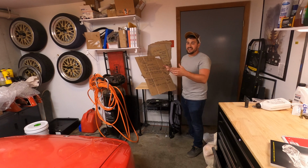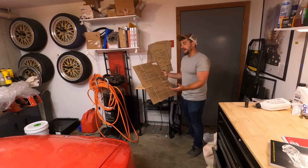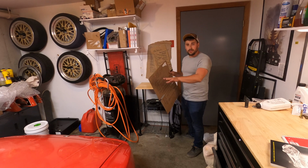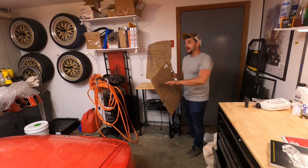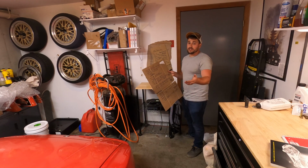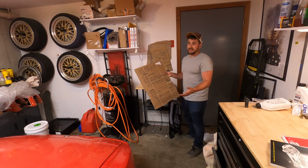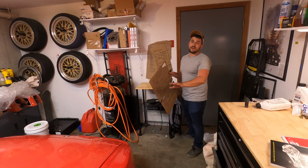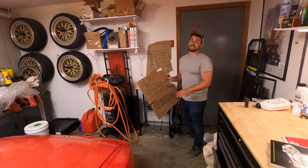So basically, I tried to do it through a DIY that I found. It's definitely not applicable for this car because it's not how the spring plates or the trailing arm are set up at all. I really ended up taking every single bolt out. I scribed the outside to get kind of a rough alignment. It doesn't look great, it doesn't look horrible. It's gonna get aligned anyway, so it doesn't really matter. But I try to get it good enough to go down the road without the whole car going crazy.